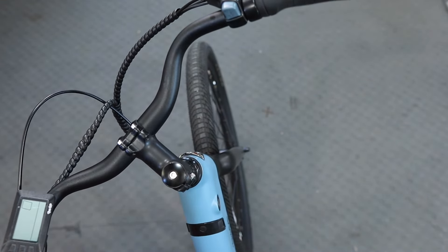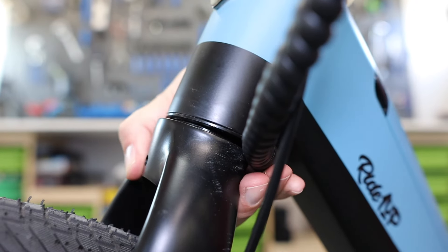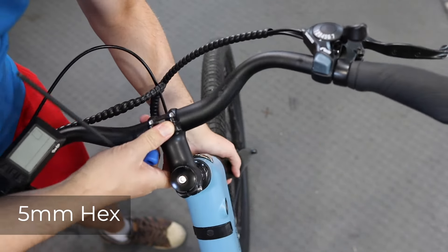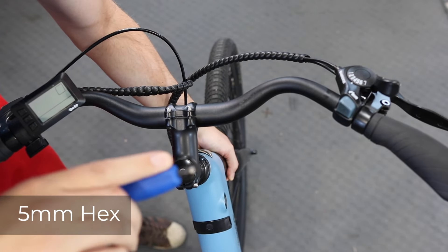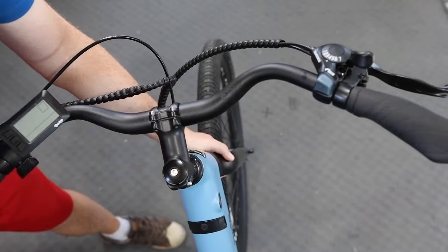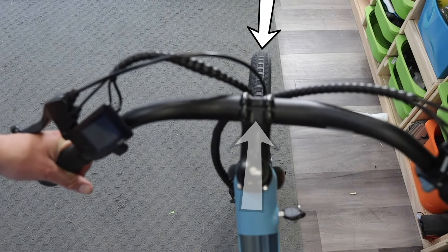Now that we've opened it up, we can put it back together. Put your hand down and pull up on the underside of the fork, and then seat the steering nice and firm in the center of the frame. With this in the right spot, tighten up the stem top cap first, and keep going until you can let go with both hands and the steering doesn't rock or tilt. With this tight first, now we can move on to getting the steering straight. All we gotta do is align the handlebars, and then tighten down the two pinch bolts.